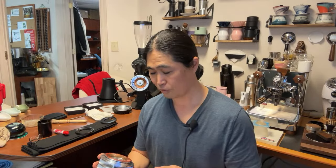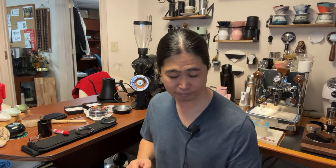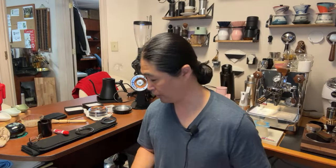Anyway, so you just gotta do one at a time, okay? Just do one at a time. Some days, if you're lucky, you're gonna get it right the first time. But if not, you just go back and forth. Usually, I know some people spend a couple of hours, okay? But this is a very easy grinder to work with. So I think you're gonna have it perfectly aligned, if you want to, with a bit of time.